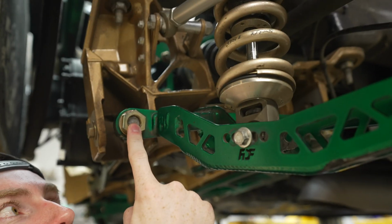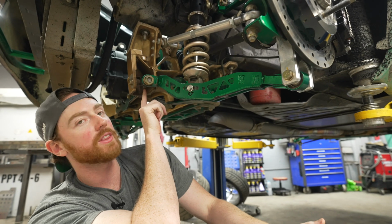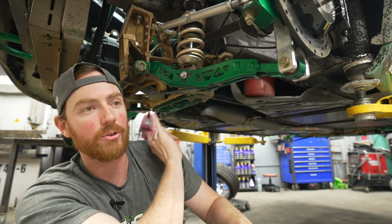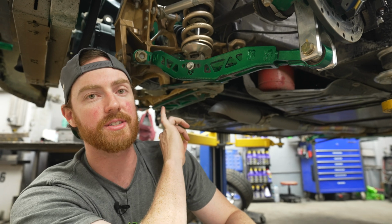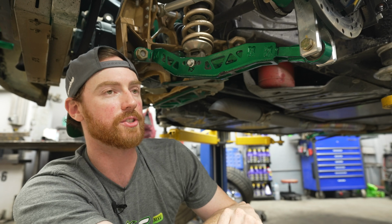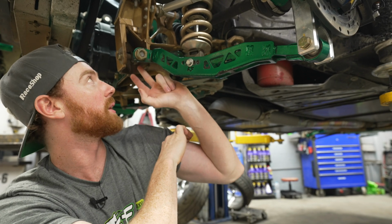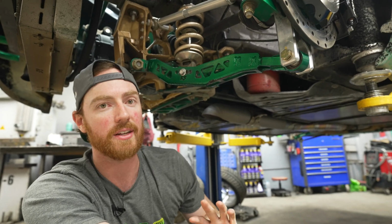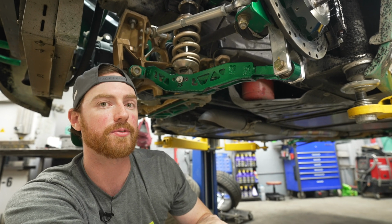Again, you can take these off on each point, and then the control arm will actually come off, leaving the Heim joints on the subframe. I can't reiterate this enough. It is so nice, if you damaged anything, to leave the Heim joints in the subframe. It is so much faster to put the arm on and take it off. I've seen too many people lose in a 5-minute timeout trying to get misalignment spacers, bolts, washers through a subframe. Doesn't matter the kit, it always is a problem. This design is a game changer in terms of fast repairs.